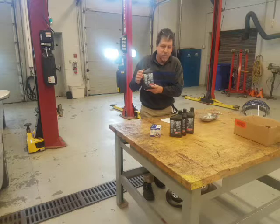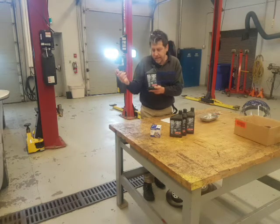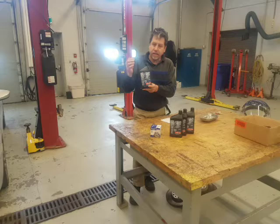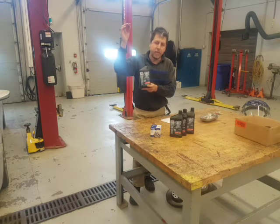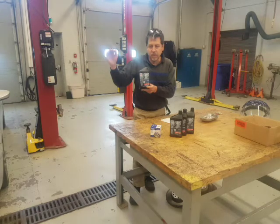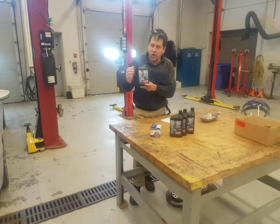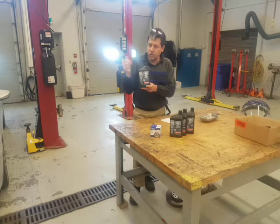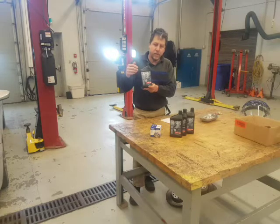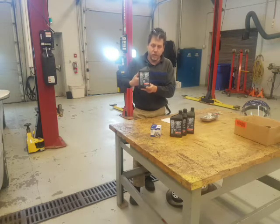Synthetic oil is not some mysterious oil — it just has better base oil. When it comes out of the earth, all oil is graded. They're both made from oil; synthetic can be made from natural gas or corn, but it's basically all oil. Synthetic oil is just better quality as it comes out — when they refine it, they get a more stable product. It flows better when cold, has less extremes, is more stable in viscosity, and can last longer. For conventional oil, unless told otherwise by the manufacturer, we add 5,000 km on the oil change sticker. For synthetic, I go 8,000. Oil is cheap; engines are not. I would rather change my oil more frequently than have to put a motor in a client's car.